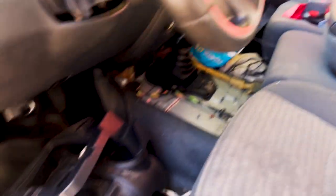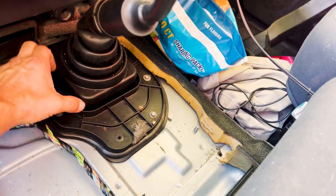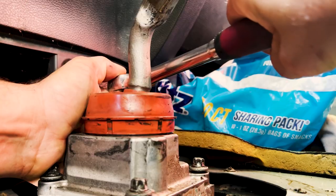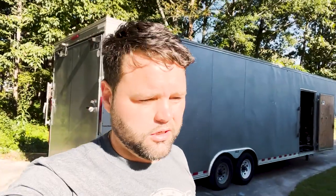That comes off first, then this piece, then this piece — it comes out. Take out your trims. If you didn't know, the shifter hole is actually a preferred method to fill the trans as well. It takes about 6.3 quarts, and if you fill it from the fill hole you can only get about 6 quarts in there, and they were seeing trucks smoke 6th gear. So I usually just dump it right in through the shifter — do like 6, 6.5, call it a day.